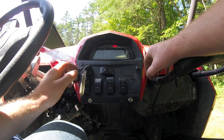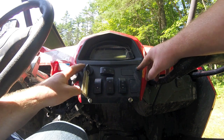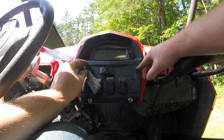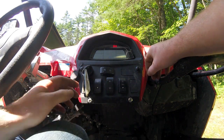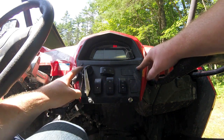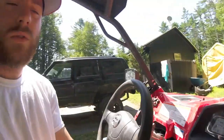Don't be alarmed, it's just your oil reset light. I'm gonna see if we can reset this. Okay, so that's how you do it. You wanna hold the two buttons down, and then turn your key on, and then that should reset your light. Hope this helps you guys.